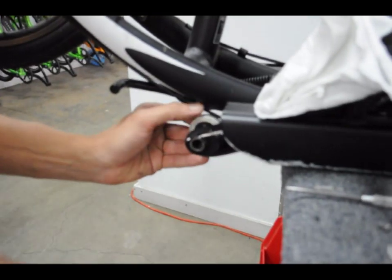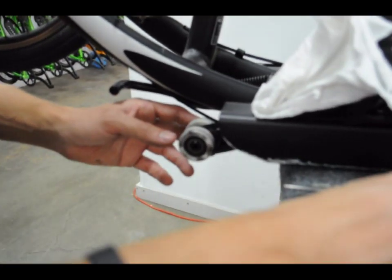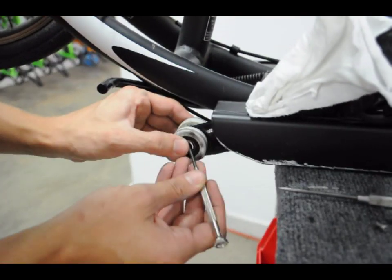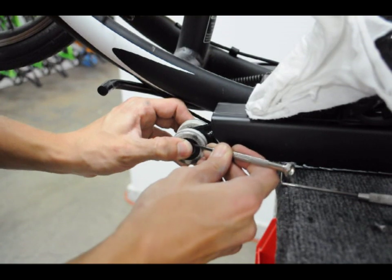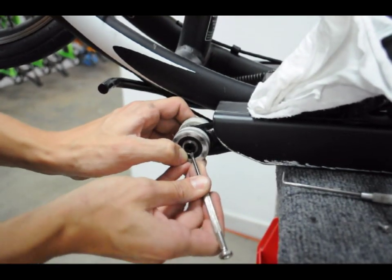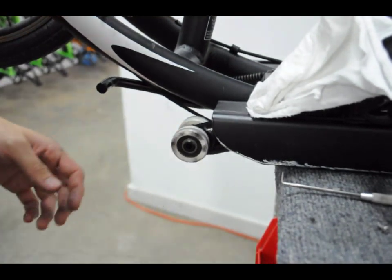Next, slide your load wheel and axle through the sides of the drive arm and reinstall the spiral retaining ring. To do that, slide the notch of the retaining ring over the axle and then spiral around with your thumb to snap into place. Make sure that the spiral retaining ring is fully seated on the axle so the load wheels do not slide off.